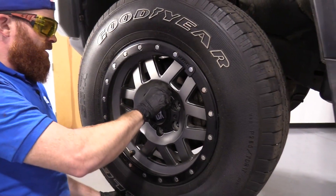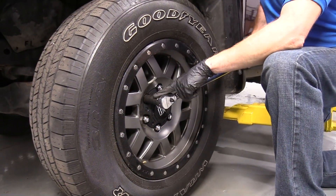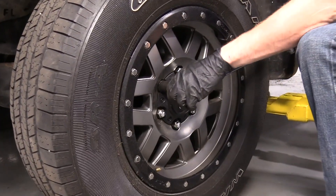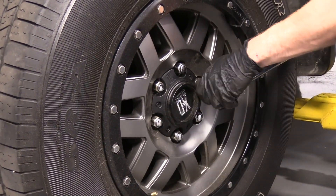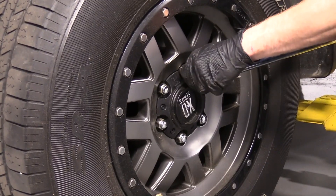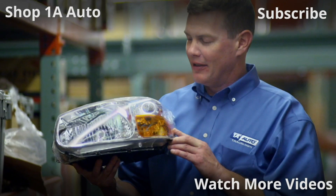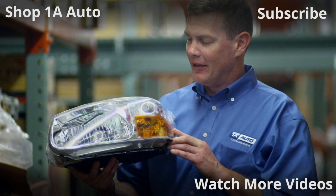Let's get that on there. We've got a few good threads, we can let go now. Grab the other five lug nuts, bottom them out, then bring it down and torque it up. We're going to take our 21 millimeter socket and torque down our six lug nuts. Try to make like a star or snowflake pattern — basically crisscross. You don't want to go around in a circle. Torque to 85 foot-pounds. Thanks for watching. Visit 1aauto.com for quality auto parts shipped to your door — the place for DIY auto repair. If you enjoyed this video, please click the subscribe button.